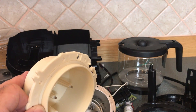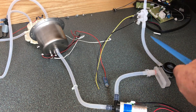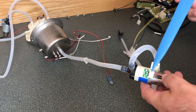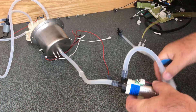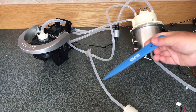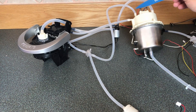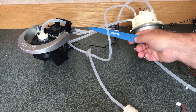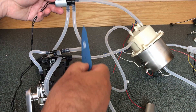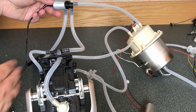Now that I know it's not going to work, I tore it all apart to have a look at the inner workings of a Keurig. The water from the reservoir goes in and the water level can be detected by the sensor. This pump has a sensor that gives feedback as to how much fluid is being pumped through it, and it pumps the water into the heating reservoir where it's heated by the electric element. The air pump goes through this pressure regulator, pressurizing the heating container and pushing out the hot water. This is a mystery tube — I'm not sure what it does, but the thing it connects to is just a blank stub. The water is then pumped out of the heating vessel, and this is a solenoid-controlled valve that controls whether the hot water goes to the K-cup or the drip filter.